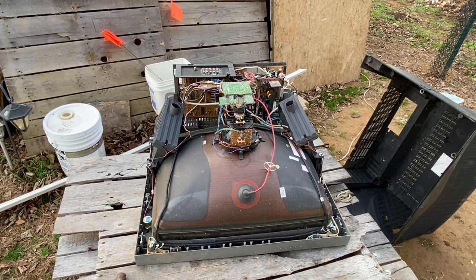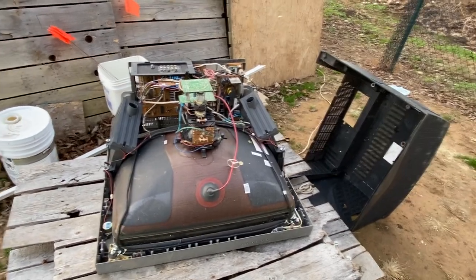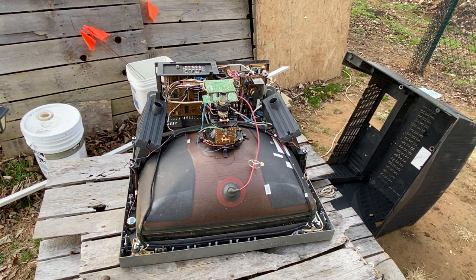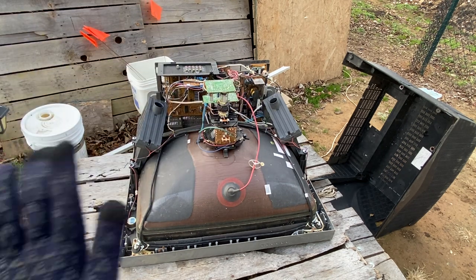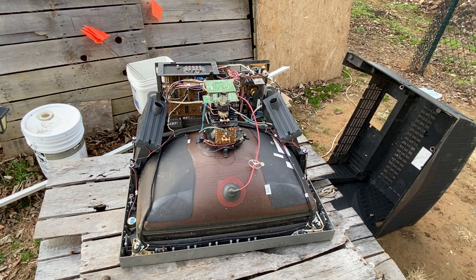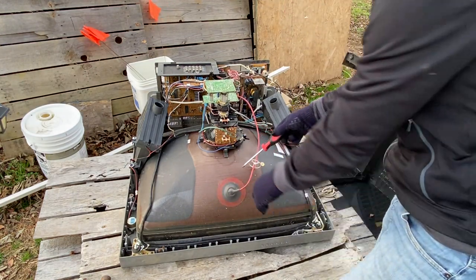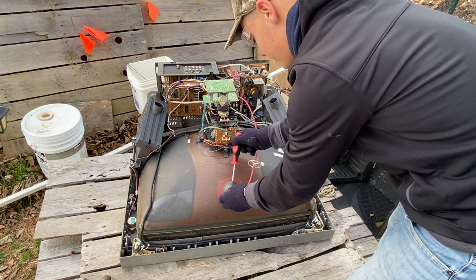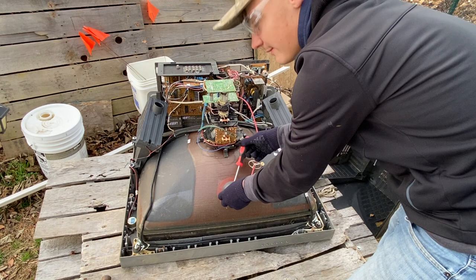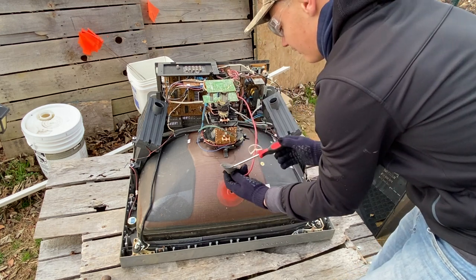So there's your CRT. I'm going to put the safety glasses on. You could use a discharger. Gloves are optional — these are rubber coated up the front. The first thing you want to do — this unit is already discharged — but you want to stick a screwdriver or a discharger inside the cap and feel around both of those electrodes.